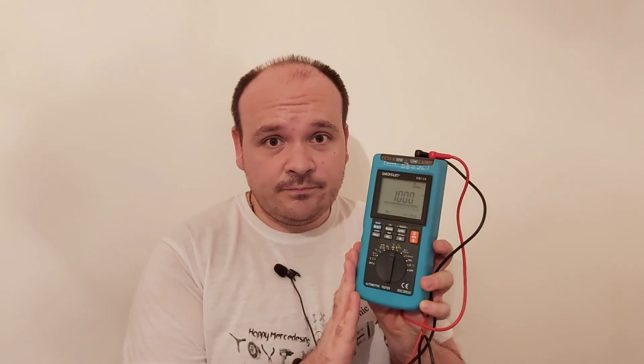I'm going to do one more video about the duty cycle before I manage to do that on my car, because I haven't managed to do it properly yet — there are some minor issues. On my Facebook page I'm going to let you know how you can do that using a common multimeter. There is another way, but for this way — and I repeat, seriously — the only possible way to do this test is by using percents, by using a duty cycle capable multimeter.